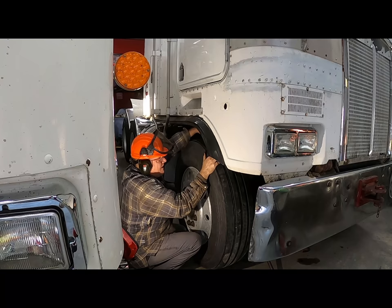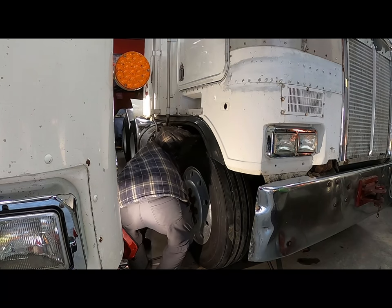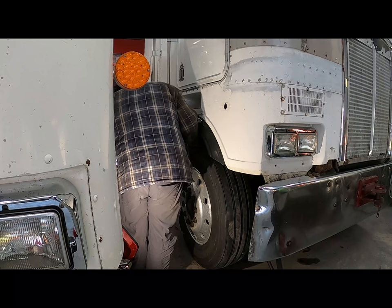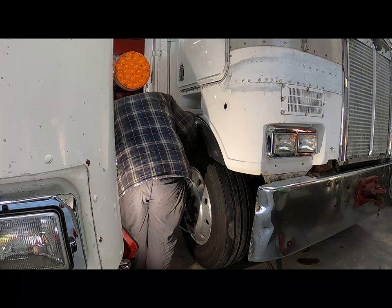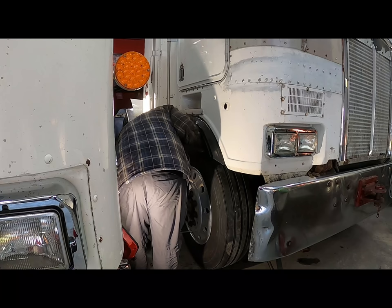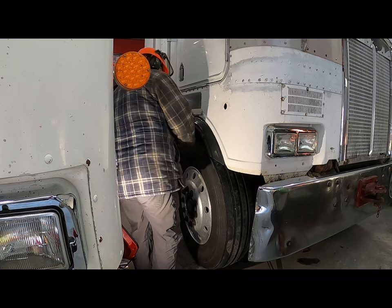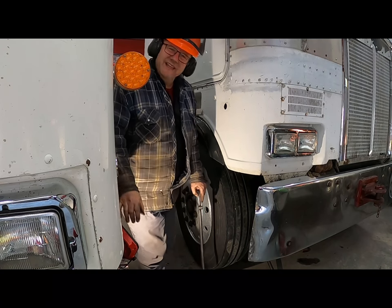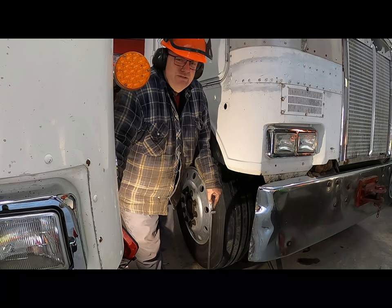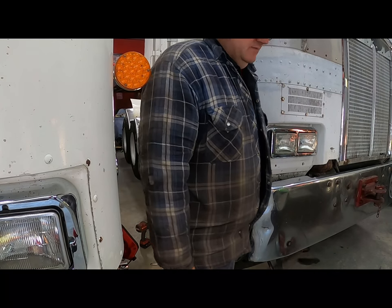I'll set it down and then torque it. And actually, if we want to check the kingpins, we can just put the bar in the wheel. It's a little bit dangerous if you've got nice wheels. And just give it a... Kingpins are good. Kenny's actually in pretty good shape. He's rustier than a mofo, but he's well serviced, looked after.